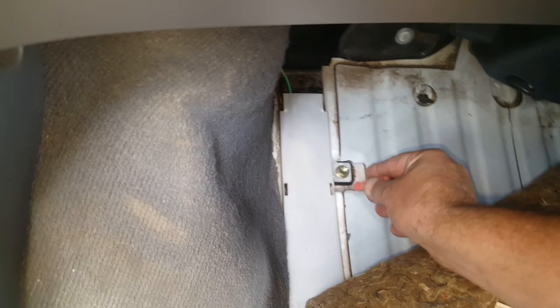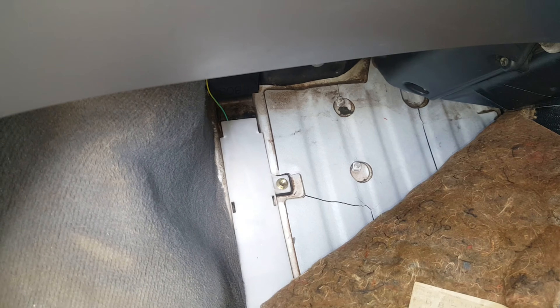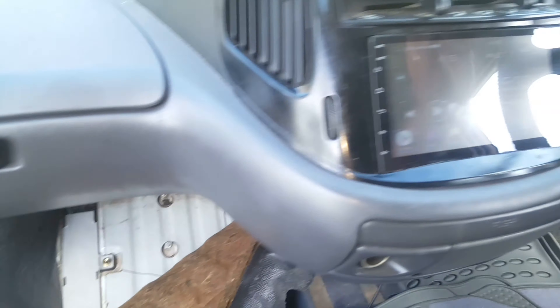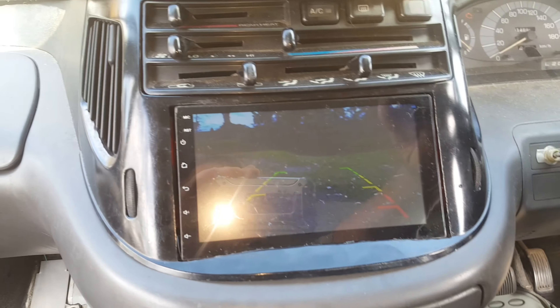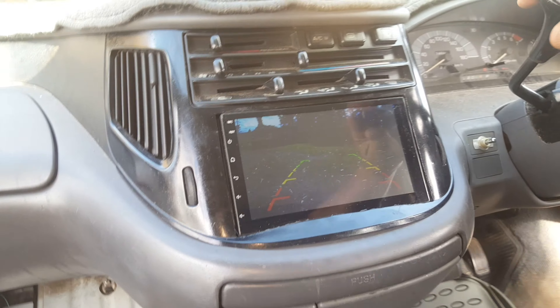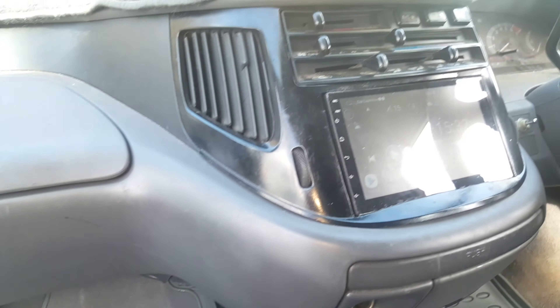See, that's all back together. So all you really do is pull back the carpet here, undo your 12 mil, undo the clips, get access to those wires, find that red orange trace, tap into it for your reverse cam and job's done. Now the tailgate's down I can show you the reversing behind me — all happy days. The van's just about finished and that's it, cover back down, job's done. Alrighty, till next time guys, cheers.